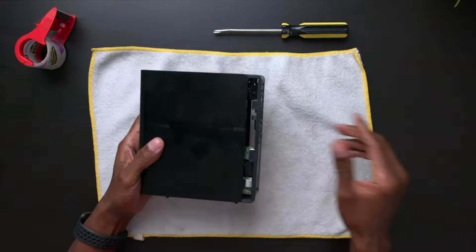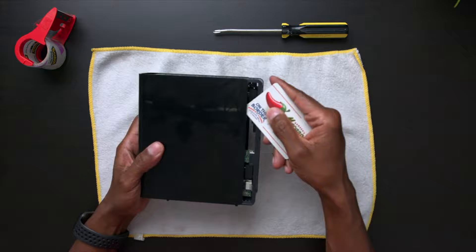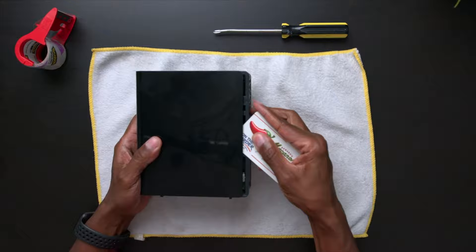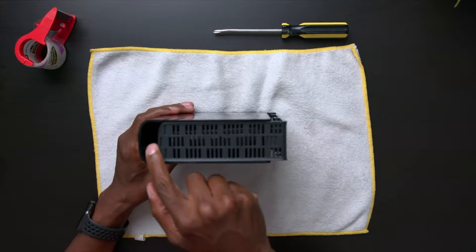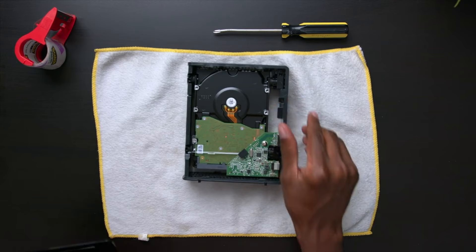All you would do is find these little plastic clips. You need to find some kind of card — so when this is closed down, you're going to find a bunch of these cards and you want to put it around these edges on both sides. Here's another look at it. And once you release these clips, you can put a piece of plastic in the front and start pushing this back. Then you would have the exposed hard drive.